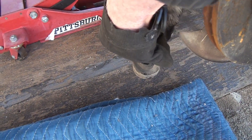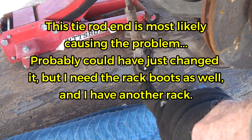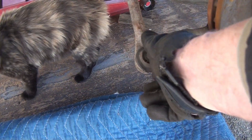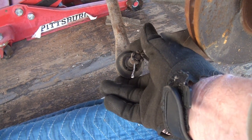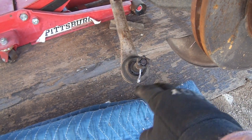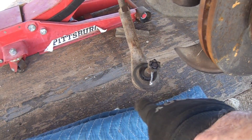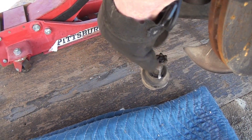I'm going to put a used rack in, and I've got one that had some grease fittings on it. See, what happens is the rubber goes and then it gets dirt in here, and then these wear. There's no way to lubricate them when they're factory. The aftermarket ones are able to be lubricated, and as you put the grease in it forces — even if the boot is broken — the grease up and out and flushes the debris out of the joint itself. So it's good again, but you got to do it pretty regularly because if you've got a cracked boot, more dirt is going to get in there. But there's no way to grease these factory ones.